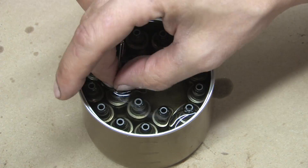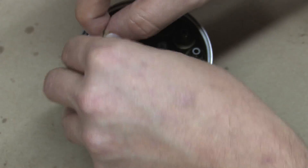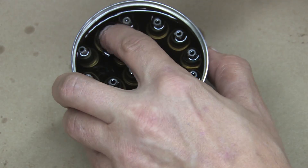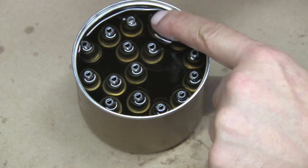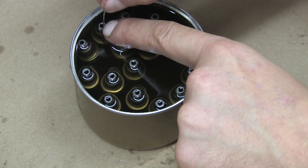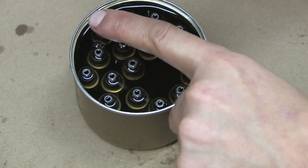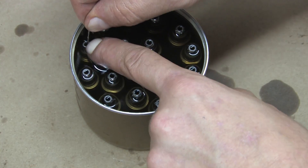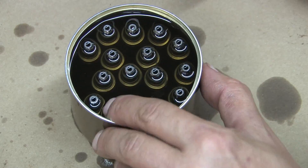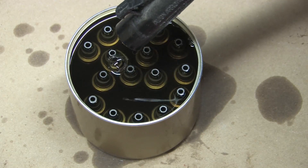Pump each lifter in your cleaning solution with the check valve open, one at a time. If you don't remember which ones you have and haven't done, just push down on them — the ones you've done should be hard as a rock, and the ones with air in them are squishy. Check to make sure you got them all, and then let them soak. My first bath is going to be a 6-hour pre-soak, and that should give them plenty of time to dissolve the sludge and dilute any leftover oil.